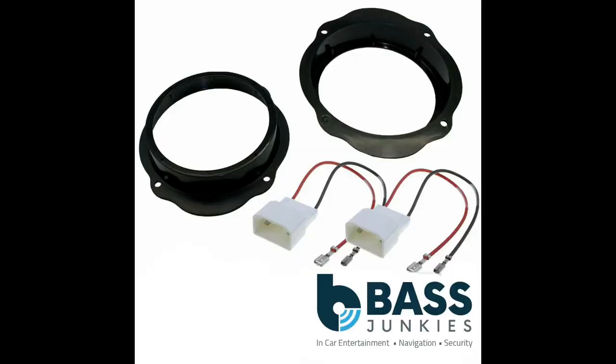The approach I've taken is a little bit heavy-handed, because the current Focus Mark II speakers are molded into a cone-shaped base and riveted onto the door itself. The standard way is to break all the rivets, take the whole unit out, buy some adapters, and put in your aftermarket speaker. But I'm not going to spend money on adapters when I can simply cut and extract the old speaker whilst keeping the round bezel and then insert my aftermarket unit onto it.